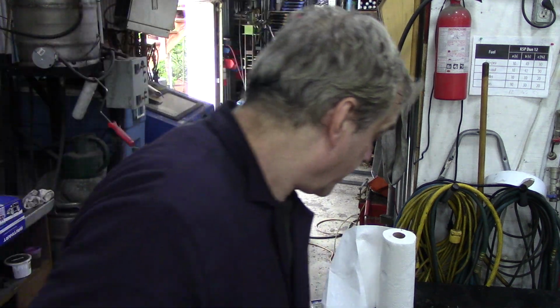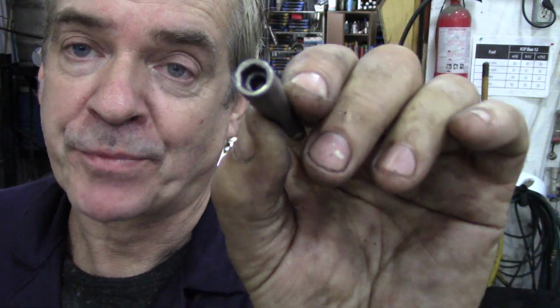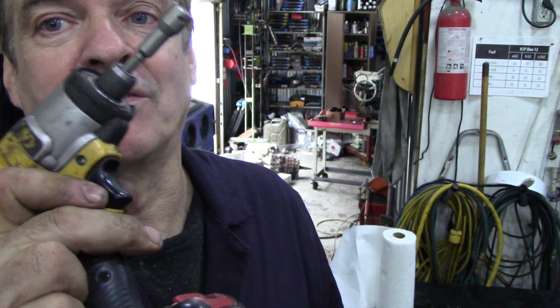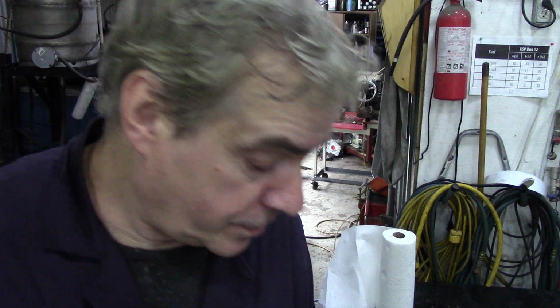And these are brilliant when it comes to these, because this is 6mm, standard size for Land Rover hose clamps. After 20 years or 25 years, I don't think many of them got the standard clamps on, but this makes your life so much easier. You can whiz round all the pipes with one socket. And then, because you can flick it backwards and forwards, I like to pull the hose clip back and tighten it back around the hose again when the pipe's off, so you know which hose clip went with which hose, instead of throwing them all in a box. All right, these are off Amazon. The long ones are off Amazon too.